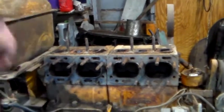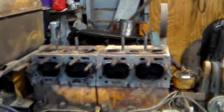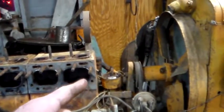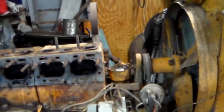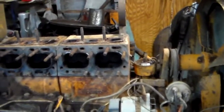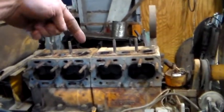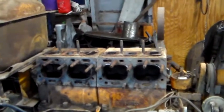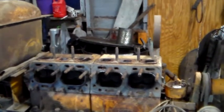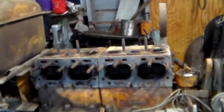So I'm going to pull those out, pull the blocks all the way out, pull the pistons out, clean the pistons up, clean the cylinders out before I put it all back together. One of the little projects I've also got to do is file the points a little bit — they were dirty and weren't sparking when I had it out in the yard. So: file the points, pull the jugs, and on the back side of the engine take the side plate off. I think you should probably just take the side plate off, pull them all off as an assembly, then pull the pistons out one at a time, clean them up, put it back together, drop it back on. That's the plan.